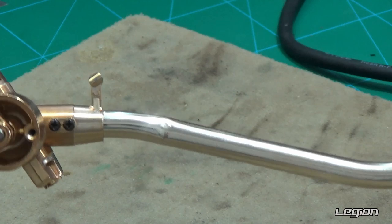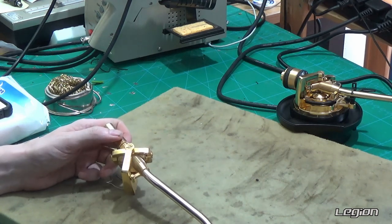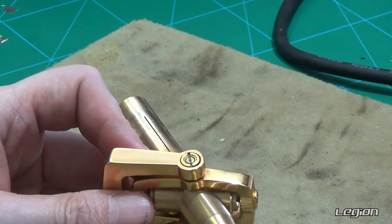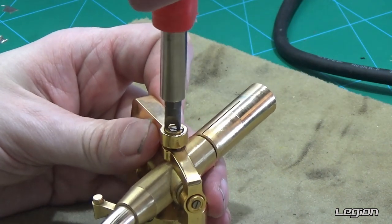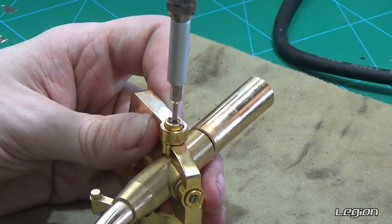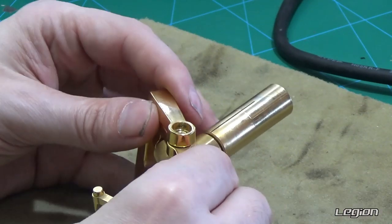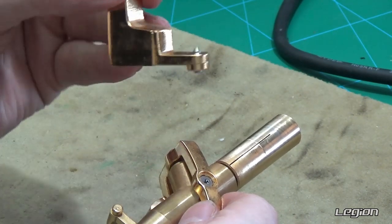This particular one has a dent on the S-bend, which would have been from pressure on the top of it, which also broke the armrest. I have a tool which I modified to fit into the bearing lock on the top. We undo the lock and then we can unscrew the rest of it. There are two bearings on this particular part — one at the top and one at the bottom. The one at the bottom is the most commonly damaged. We can also see the pin where that sits, and that can also lose its point, which will stop the tone arm from moving correctly.